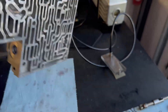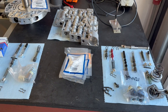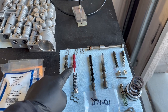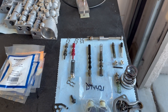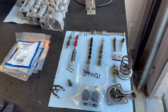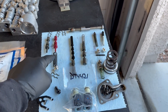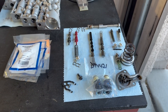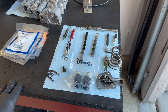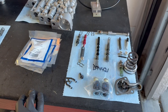They also did not leave out the number six flow control check ball for the coast clutch. We'll do that here. We're also going to install an oversized drop-in actuator feed limit valve from Central Valve Bodies — this circuit was testing at about 12 or 12.5 inches, which is borderline sketchy. A drop-in valve should bring it up to 15 or so, which is where we want to be. I'm also going to shim this valve with an inner spring from a Transgo shift kit so it receives the full benefit of proper solenoid pressure feed to all the solenoids, particularly the EPC or electronic pressure control solenoid.